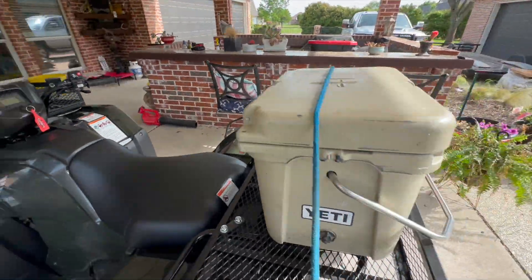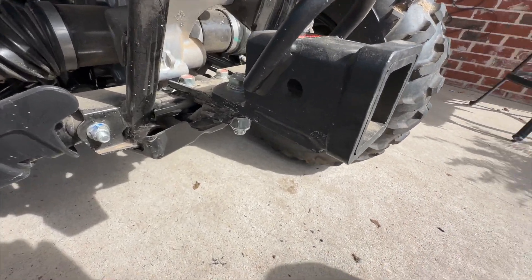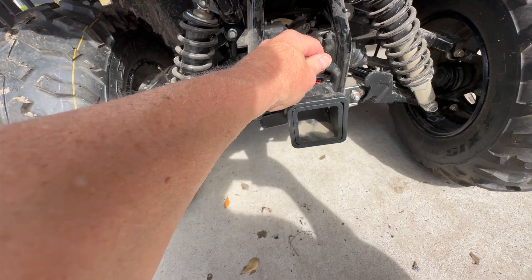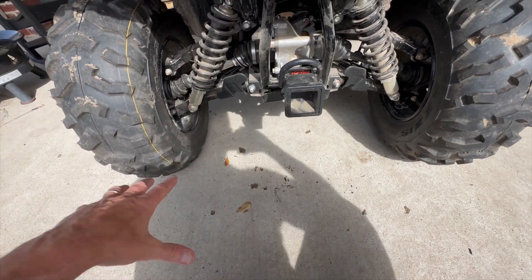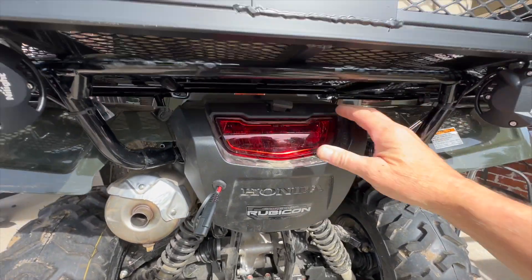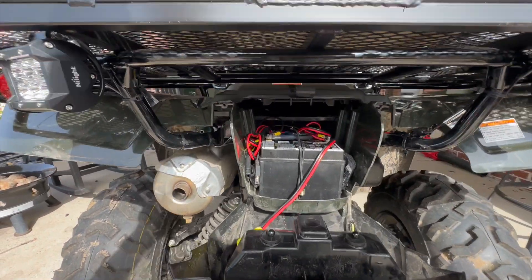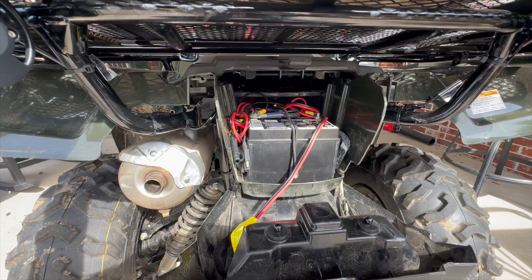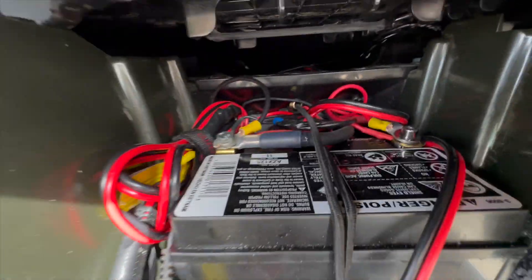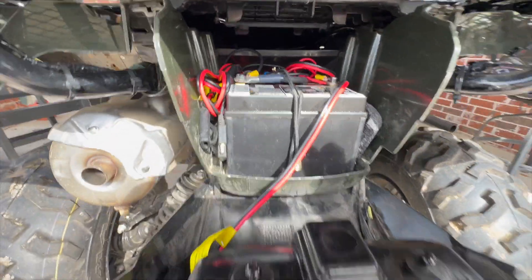We did two more upgrades. We added a top-toe two-inch receiver adapter, and once again, this is not for heavy loads — this is for pulling a little lightweight utility trailer. We actually put a sprayer behind it for spraying in the pecan orchard. Now, one problem we used to have with our Polaris Sportsman was that we just didn't have enough battery power. We would pull on the battery and it would actually cause the battery to drain, which would stop the electric fan from working, and we would overheat on the Polaris.